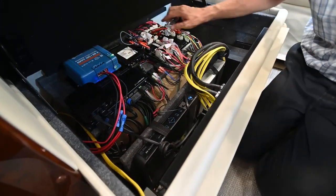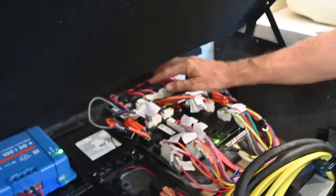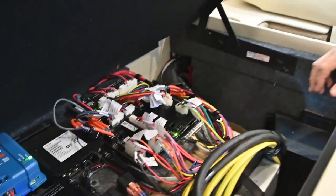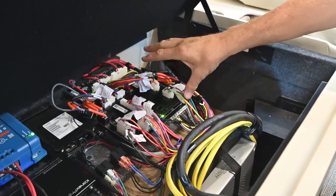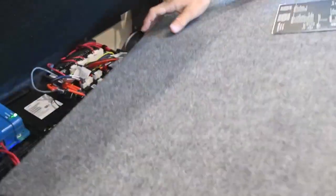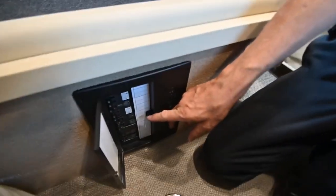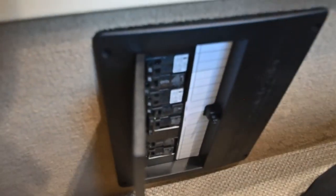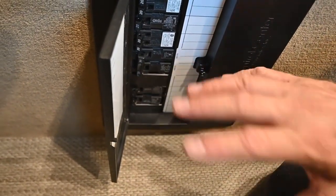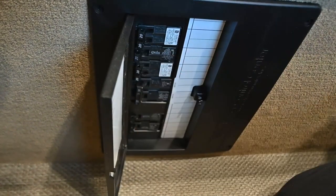Right up here there's what we call a fuse module. When we operate switches inside off the Firefly, it's activating some relays on here - that's how we turn on the lights and the shades. This is the heart of that system right here, but we have to have good battery power to run it. There's also a place here for the breakers - we have all the house breakers for the microwave, the TVs, anything powered off 120 volts, and then we have a 30 amp main coming in from the shore power. If one trips, just come back and push it back up to reset it, just like at home.